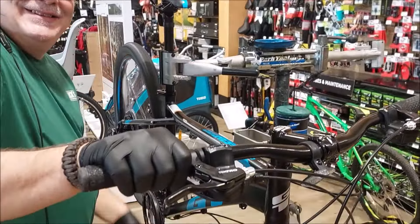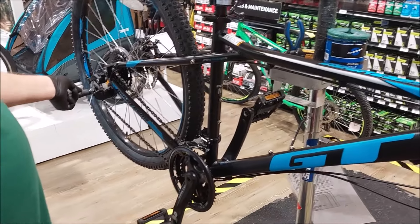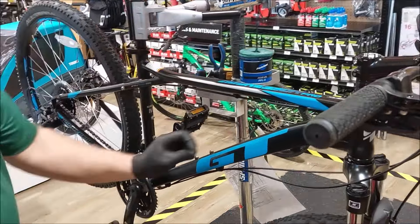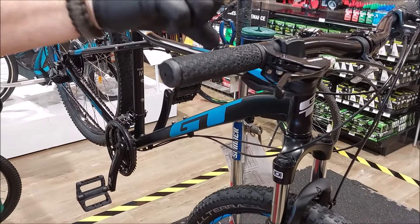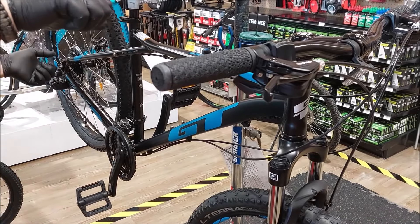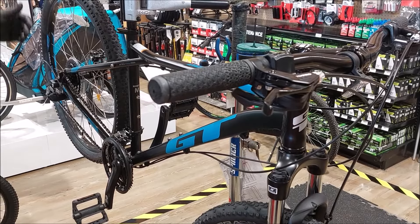So what were you explaining about the gears? With the cable on the gears you have your shifter and your derailleur. There's a locking point on the derailleur and a locking point on the shifter, and you have a specifically metered amount of cable. When you shift, the cable moves the derailleur; when you downshift, it moves back. You want those to be in tune with each other.